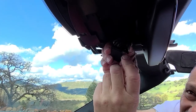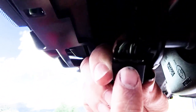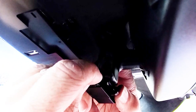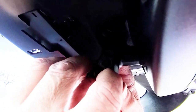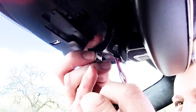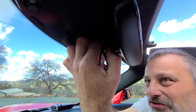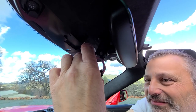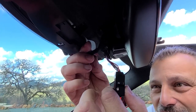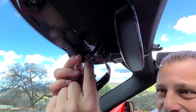Now, right here there's a little press tab right there — see that? That will release this plug. So you can push in right there. There we go, and that separates just like that. Now, you want to try to pull that wire down just as much as you possibly can, because they usually leave a little bit in there. This big plug is the side of the mirror — this is the power side. So we're going to be tapping into this side of the plug.